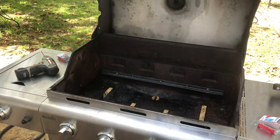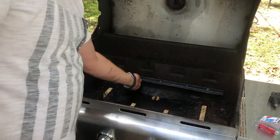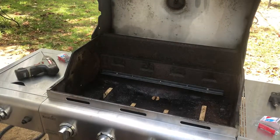Okay, why would I use a rivet over a screw? Because a rivet's permanently there. Screws, when they heat, the threads start going bad. Threads will start melting. Threads are usually weaker than the thicker parts of it.